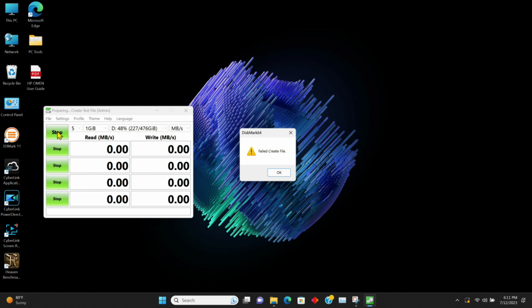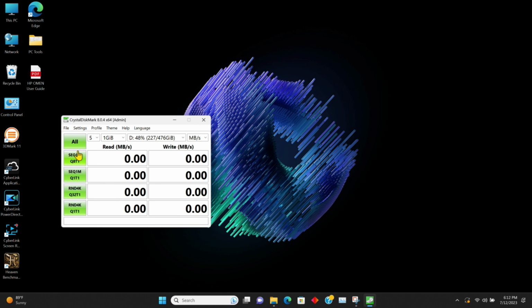For some reason it does not work here. Let me connect it directly to the computer and see if I can get that to work. Here, we'll start it again, this time directly connected to the USB-C port on this laptop. That looks like it's working. Yeah, it's working, so I'm going to go ahead and stop this. It looks like the actual USB-C port coming out of the Intpw one is not fully featured. It doesn't have the same capabilities as the one on the computer itself. So that's something to keep in mind. If you plan on using that port, you might run into a similar problem.